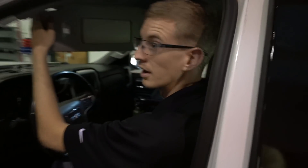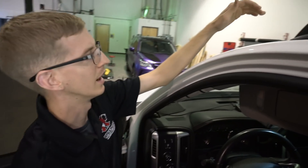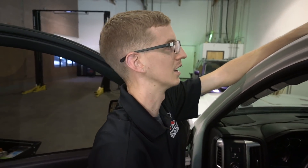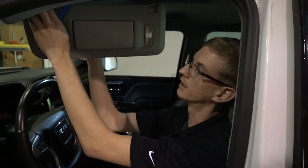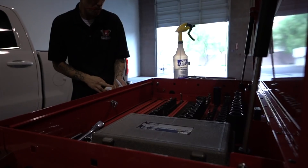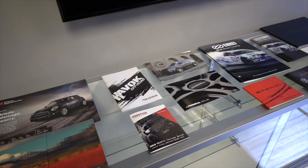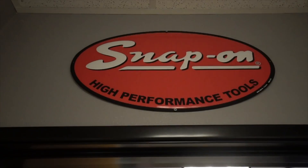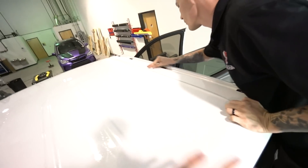Justin, what do you got going on in here? I am dropping the headliner in order to get to the bolt that attaches the antenna. That way it's a lot cleaner of a wrap — we're not trying to over-stretch getting it around or have to butt it up or seam it anywhere up in here. The hold-on handle — it's two ten-millimeter bolts, and from there you pop this guy out to get to a couple screws, and that'll drop this out. We have to get the secondary handle up here and then the whole thing will drop down enough that we can get in there.